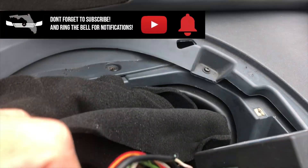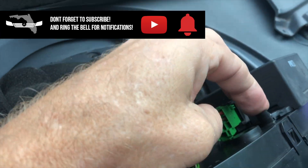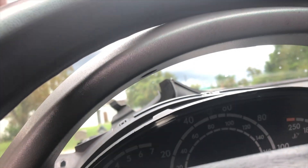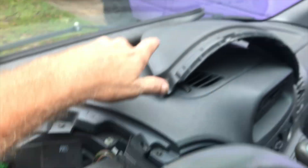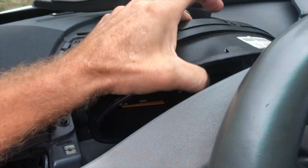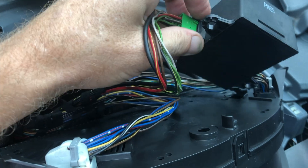The SKREEM is typically mounted to the back of the speedometer here. We just push on this little tab and it lifts away. To get at the top, there are two screws up under here in this arch, then the vent lifts away. There are two screws here and on the other side of the half moon, then that lifts away. Then there are two screws on either side of the dash cluster so it tips forward — it'll even lift out if you wiggle it, so you can really get at the back side.